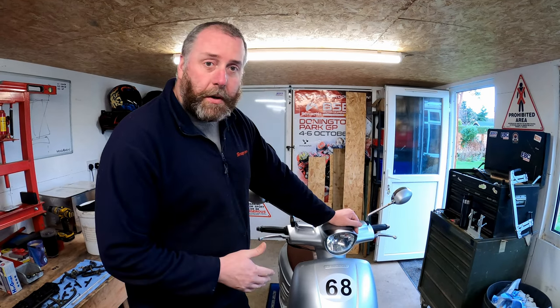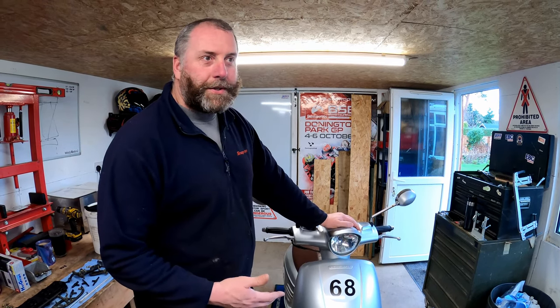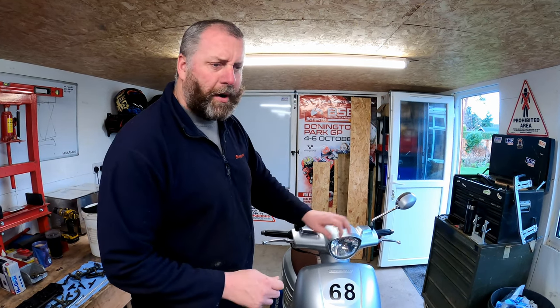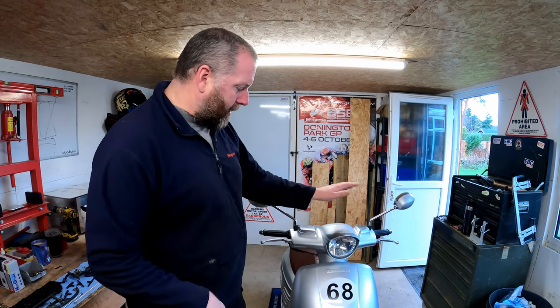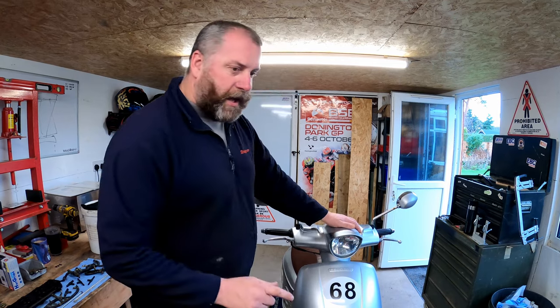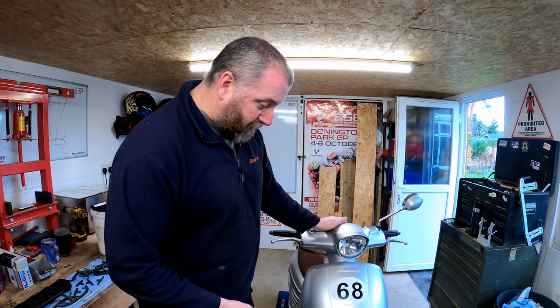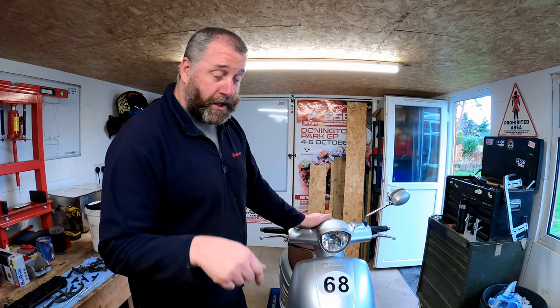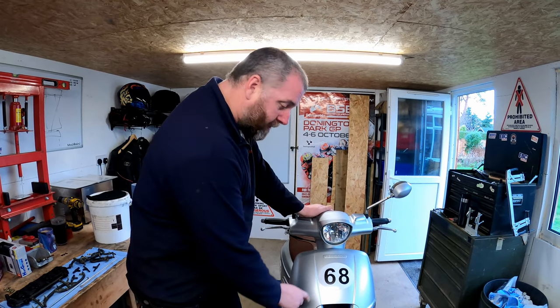It's a little bit more involved on a scooter than a motorcycle because there's a lot of plastic to move the cables through. The battery is right at the back and the grips are at the front, so the cable will come down the bodywork, under the footboard, to the battery. There's also a switch which I'm going to mount in the kick panel — so we have to drill some bodywork. What we're going to do is remove bodywork in a methodical order, as detailed in the workshop manual, which I'll link in the description.